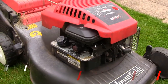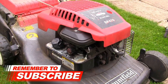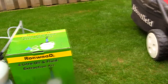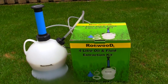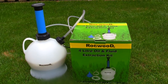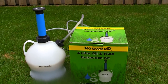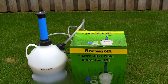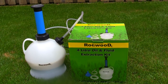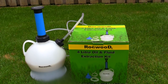I hope this video covers which way to tip your petrol lawnmower up. As I've said, try to tip it carb-side up if you do have to do it, and try to run the fuel out first so there's nothing going the wrong way. But I would absolutely not tip a lawnmower up unless I absolutely had to, and I totally recommend this Rockwood 4 litre oil fluid extraction kit. Please subscribe if you like what you see, click the bell notification icon, and at the end of this video there'll be links to some of my most popular uploads. Thanks for watching and I'll see you again shortly.